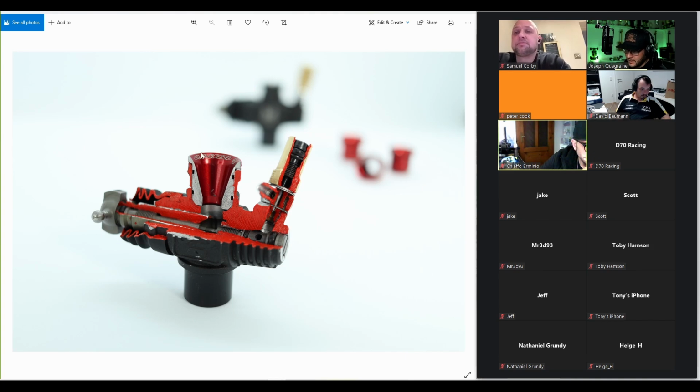So what's going on? Basically, air is flowing through the air filter down the venturi into the carb body. At the same time as the engine is idling, fuel is flowing through here, through the metering valve, out the spray bar, as much as the low speed needle allows. For the engine to run right, it's a mixture of the air that's flowing in and the oxygen in the fuel reacting in the combustion chamber, in the combustion event, causing an explosion and then pushing the piston down. So we have a set amount of air that's coming in. We set it, we measured the idle gap, that's the amount of air that's going in. We don't need to change that, we know that. So what we are doing is we are just adjusting the amount of fuel to match the air.